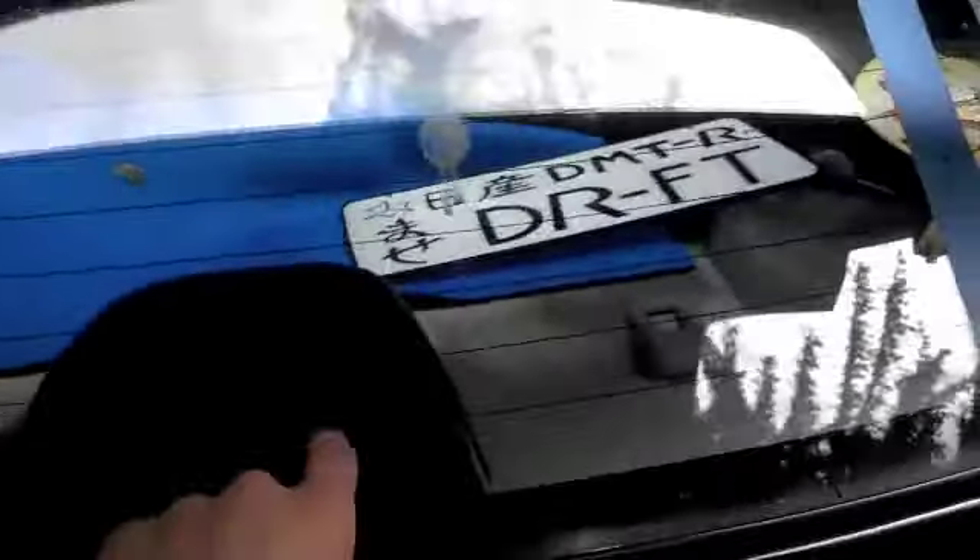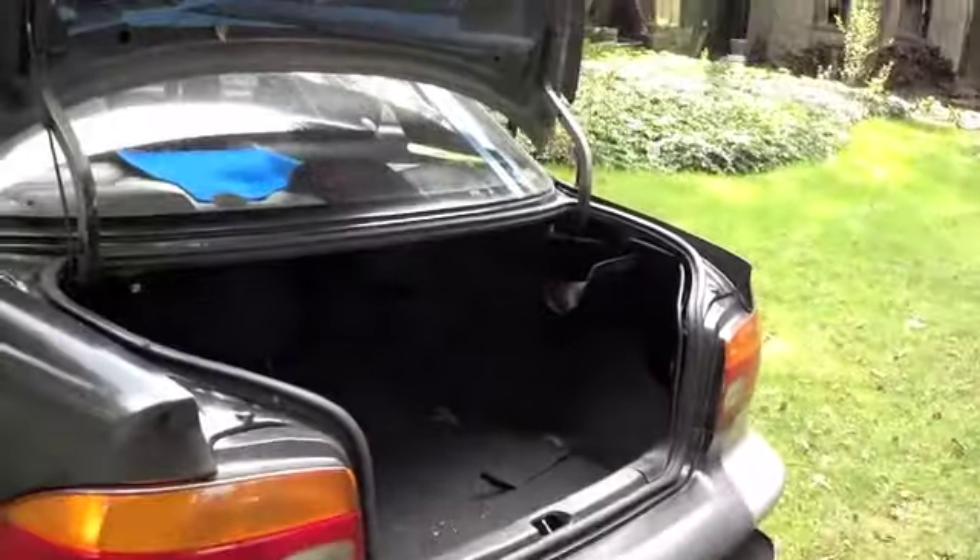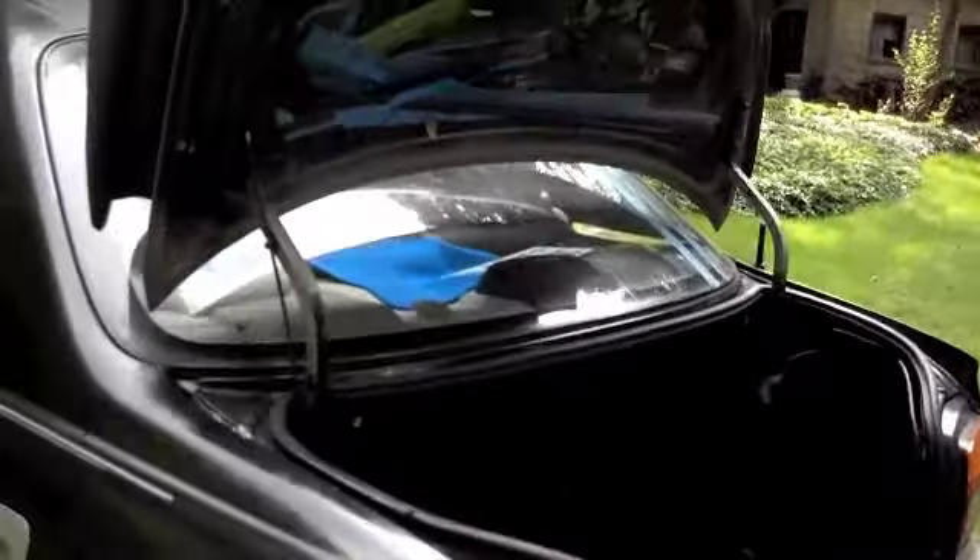The back panel behind the glass is still tan, but I did spray paint the brake light area black, so that looks cool — kind of blacked out. While you're painting, you use a lot of painter's tape, so a trick I do is put all my used painter's tape up here and reuse it as much as I can, because it's expensive. The frog tape is a dollar extra but worth it — you can see the difference compared to regular blue painter's tape.